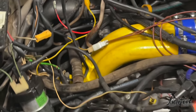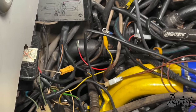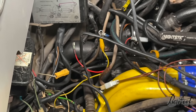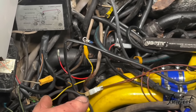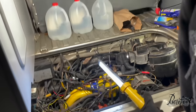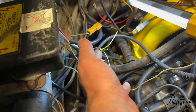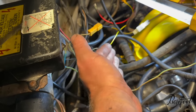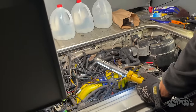How do you fix that otherwise? All you need is the center wire going to the oxygen sensor. So you can just cut it back and strip it and put a regular connector on it. And that shielding is just... So you just cut it straight so that it's not grounding itself. So even though it's not hooked up, that's the hack, because cutting it back means it's not grounded out. Right. Okay. So start it up again and see what it does.